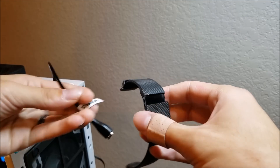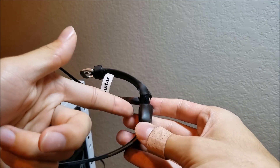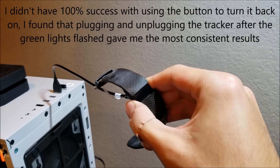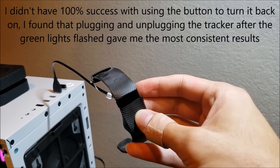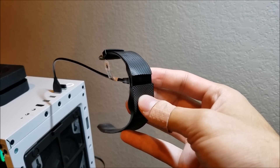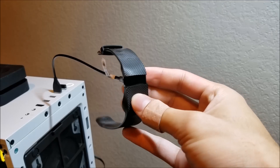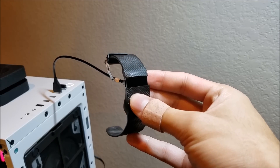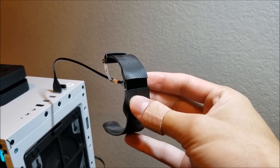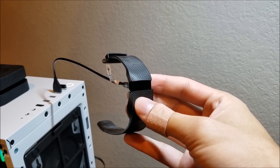To complete it, all you need to do is power it back on. I suggest you plug it back in and wait until the lights start flashing again. Then try holding down the button for about three to four seconds and it should spring back to life. If it doesn't, I found that sometimes just letting it sit on your desk unplugged for about a minute, then pressing the button as if doing a first-time startup, gets it to turn back on. You should then see the time showing zero zero zero on your screen — if it says that, you've performed a successful reset. If not, there's a good chance you missed one of the steps and should try again.